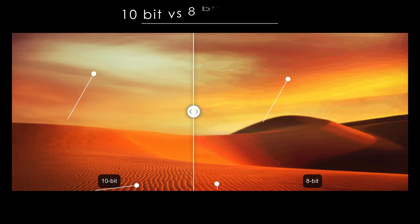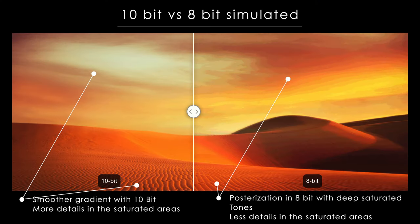What's happening on the display is that some pixels are changing color somewhat rapidly in order for you to perceive a visual 10-bit picture. Many manufacturers list their display as a 10-bit panel, but the majority are implementing 10-bit via FRC, very similar to what BenQ is doing here. If you go for a true 10-bit display, take the price of either of these displays and multiply it by two or three — that's how much more a true 10-bit panel costs.